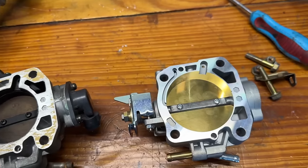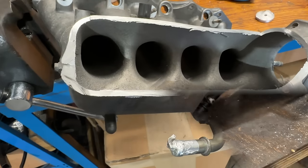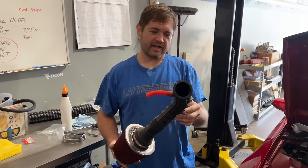More power before and after VTEC with a really aggressive changeover. The engine is completely freshened up. We're going to cut the intake manifold open, run a 70mm throttle body, basically clean up the intake manifold, open up the ports, make it flow a little better. That's not even enough for one runner of a K20.